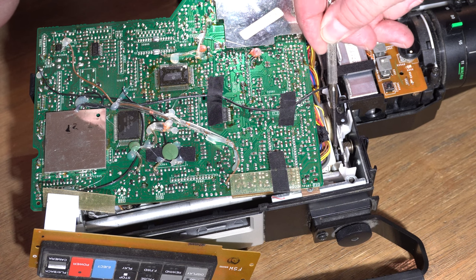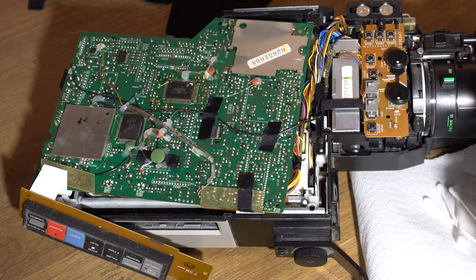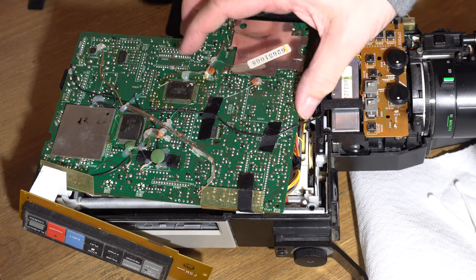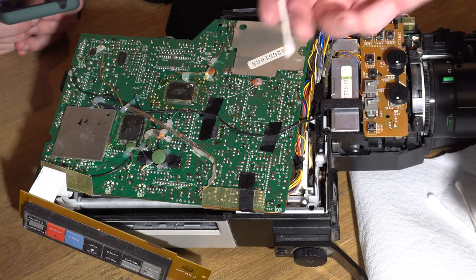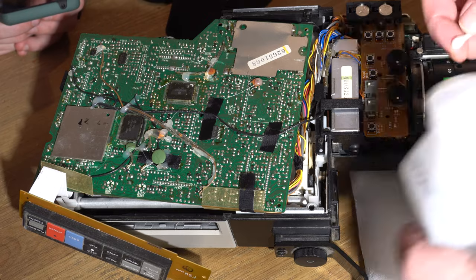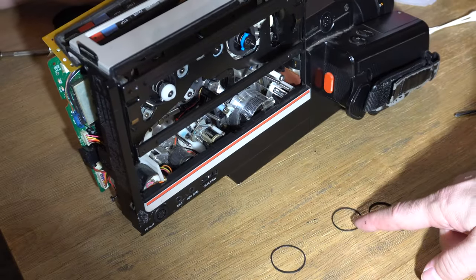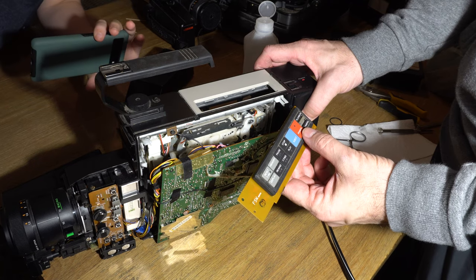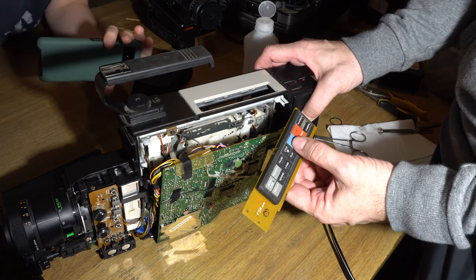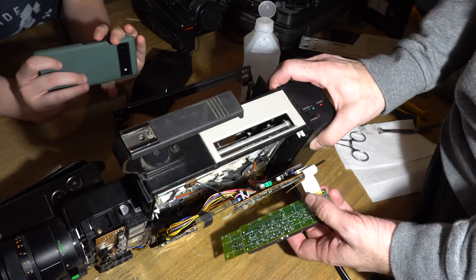This belt here is completely gone, and there's goo on it. It reminds me of surgery — you're dealing with something very complex you don't fully understand, but you know enough to get in there and work around and try to fix it, with the danger that you could hurt the patient. We tried the middle-size replacement belt. Powering it up — it has power. Now trying eject — it worked! We ejected it. Made a weird noise, but that belt's good enough.